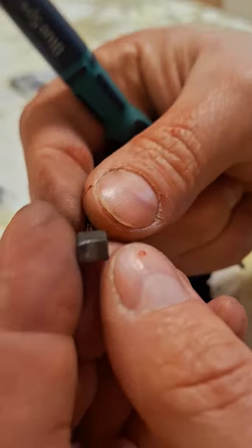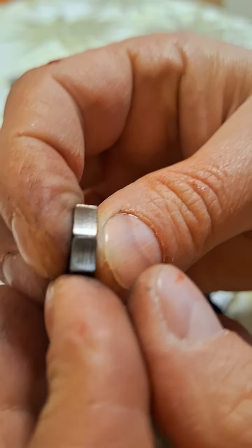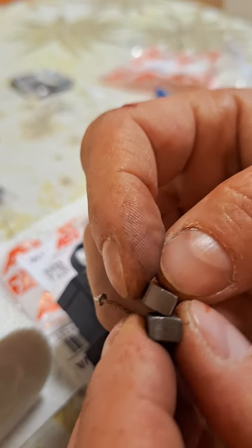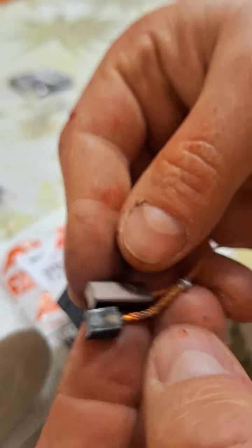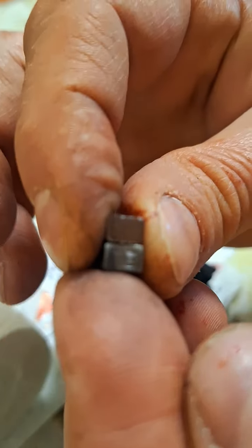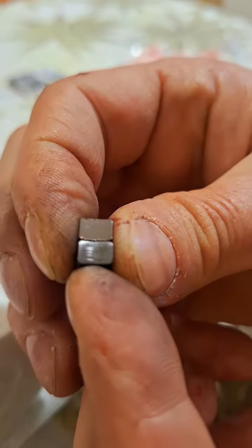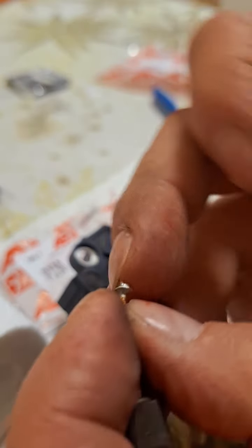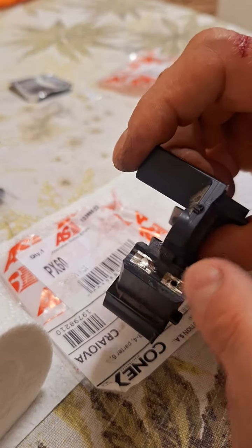This is the original brush — you can properly check them now. As you can see, they are identical in size. The aftermarket ones from ASPL have more copper inside, so they may be a bit less durable, but I think they will transfer current better than the original ones. I'll check that with the multimeter after I replace them. They are the exact same dimensions, and the welded ones usually have a piece of metal welded on the side in order to properly stay in position.